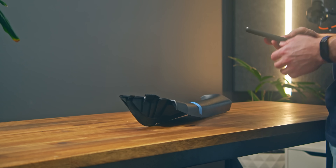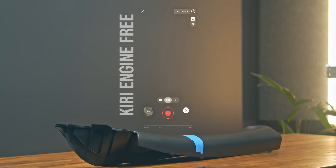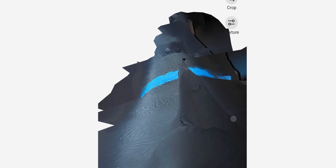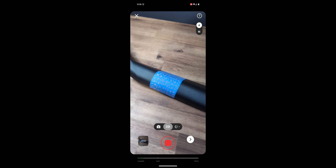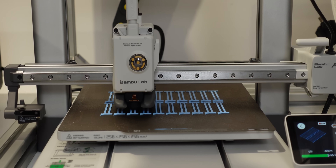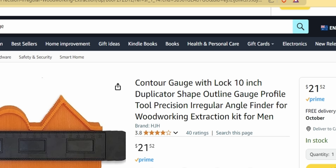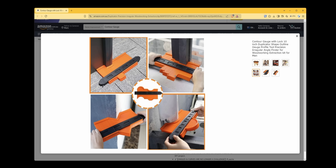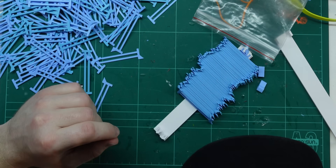To get a 3D scan of the pillar, I downloaded some photogrammetry apps and Kiri Engine gave me the best results for the free options available. But like most, it struggled with smooth plain surfaces. So I added some unique markings to some tape where I wanted them and that scan was better. But then I realized I need to scale that scan to trace it — so why don't I just trace the exact curve I need to measure? I found this cool tool online called a contour gauge, used in woodworking to trace the contours of a surface. I found a 3D-printable file, which I'll link below, that should do the trick.